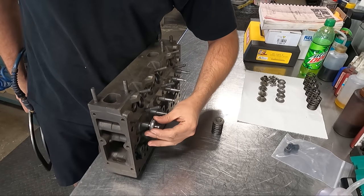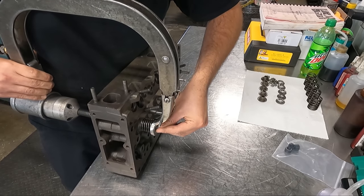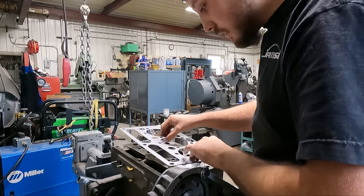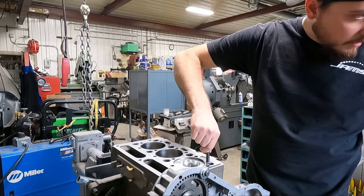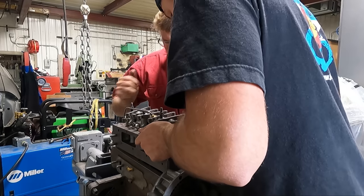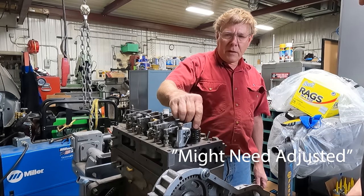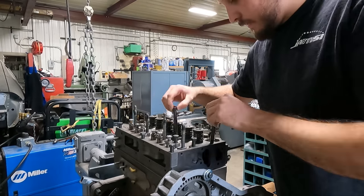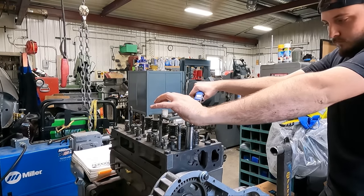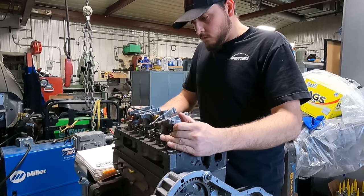As always we install our new valves with a little bit of assembly lube on the valve stem. It's really a pretty simple head to go together — there are some little locators or shims under the springs and the typical retainers and valve keepers to keep the springs in place. Back in the assembly area we can get the head gasket set in place — this engine does have two head studs while the rest of the fasteners are bolts. This little head has like 18 head fasteners torqued to spec in multiple steps following a specific recommended torque pattern — it's really kind of complicated for how small it is, but it's what you do.